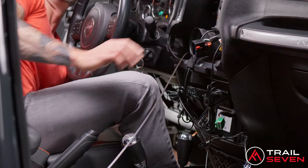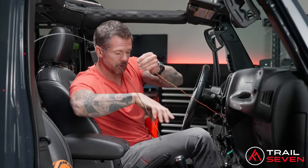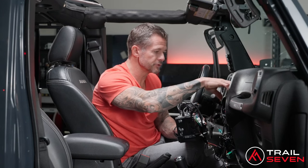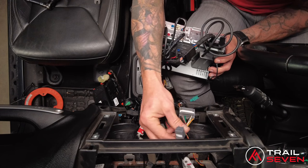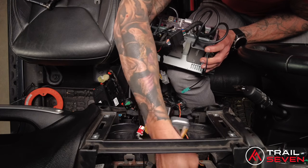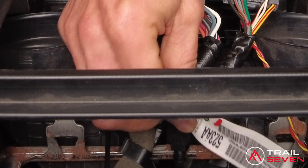Now that you have the cable attached to your fish tape or hanger, feed it through. Now we're ready to reinstall the cabling — this is just really matching port to port on the cables from the Jeep with the head unit. There is one cable that is not going to be retained, and that's what we disconnected with the Uconnect — go ahead and tuck that one down below. You will not need that for the new installation. It's the little square gray one, and in this Jeep it has a manufacturer's tag showing model number 523AA, if that helps.